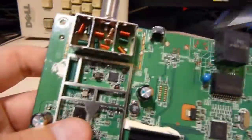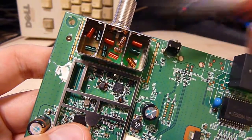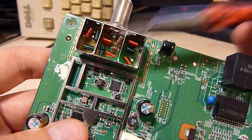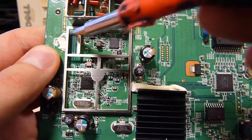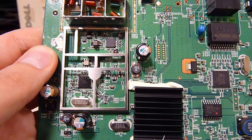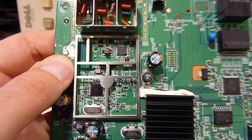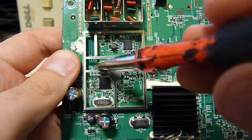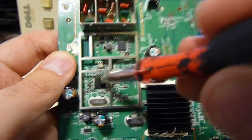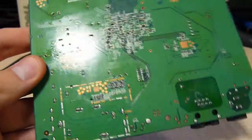After the shielding cans are opened, right here as expected this all runs at RF — I don't know the frequencies, I haven't googled them. Down here we have the control conversion circuitry from the RF. I think they call it the IF stage. I'm not exactly sure, but this looks somewhat similar to something like an analog television tuner. This will be your main RF conversion chip. We've got a direct line all the way down into this can, but the can does have several output points.